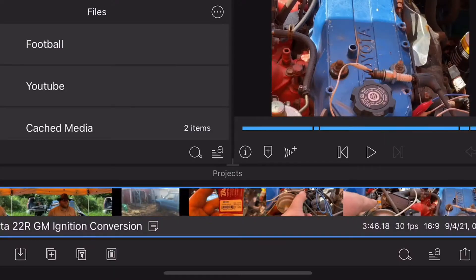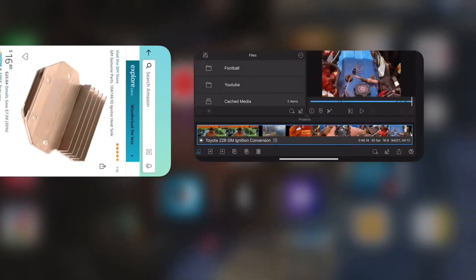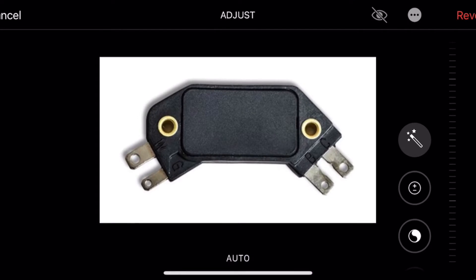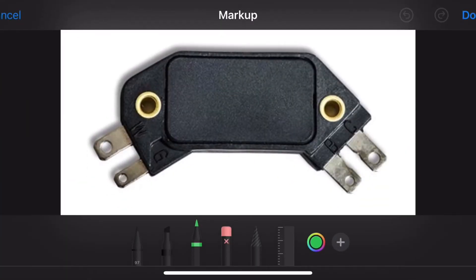So I'm sitting here editing this video and it's turning out craptacular, so let's just talk about it a little bit. This ignition module needs a heat sink — I'm going to give you the part number in just a second. It needs to bolt into it with thermal paste, and the thermal paste comes with it when you buy this. Be sure you do that; you'll blow it out if you don't. There are a couple of tests you can do and I will put links in the description on how to test if you've blown yours out.